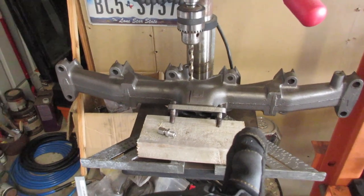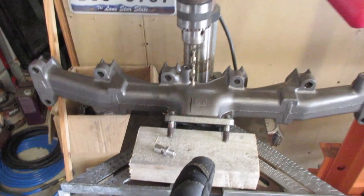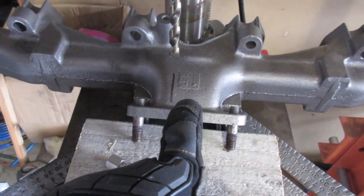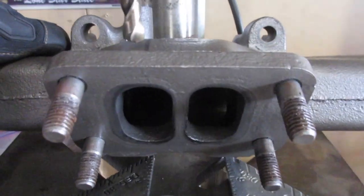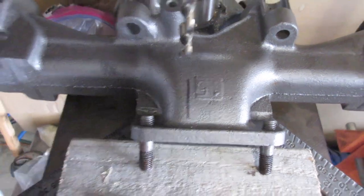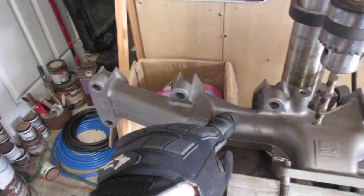I'm about to drill and tap for the EGT probe on the exhaust manifold. I got it off the engine to make it easy and got it up here on the drill press. One thing to note on the Cummins exhaust manifold is it's a dual port — so if you're drilling on the vehicle, you don't want to drill in the center where you think it's a perfect spot, because you'll drill right into that wall. I'm going to drill at the end of the center line on this side because the hottest exhaust is going to come from your back cylinders.